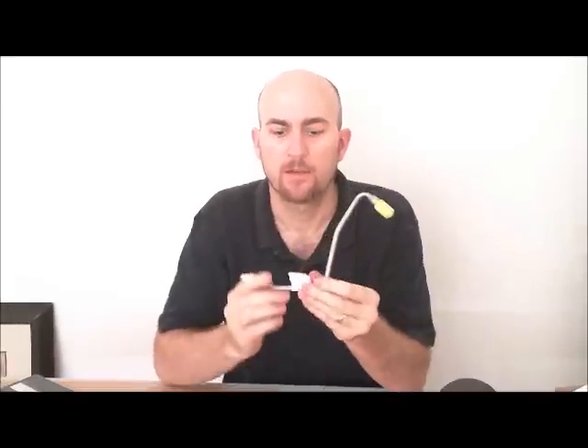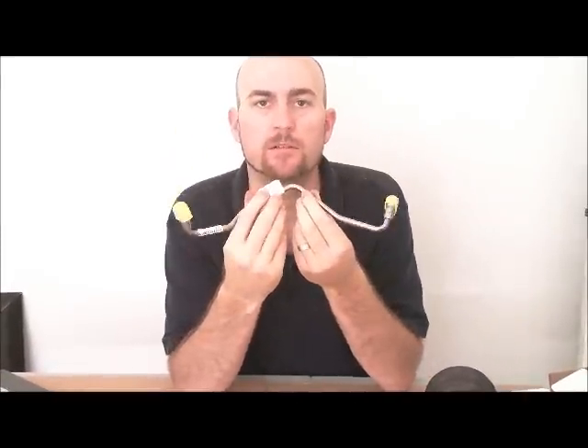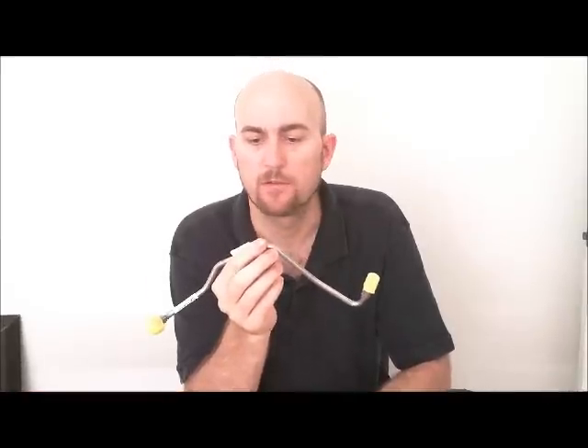As I said earlier, the most important thing after changing a new turbo is to replace the oil supply line. Here is the oil supply line. It will cost you possibly just under a hundred dollars from the manufacturer or dealer, and you can even buy it at various other vendors.